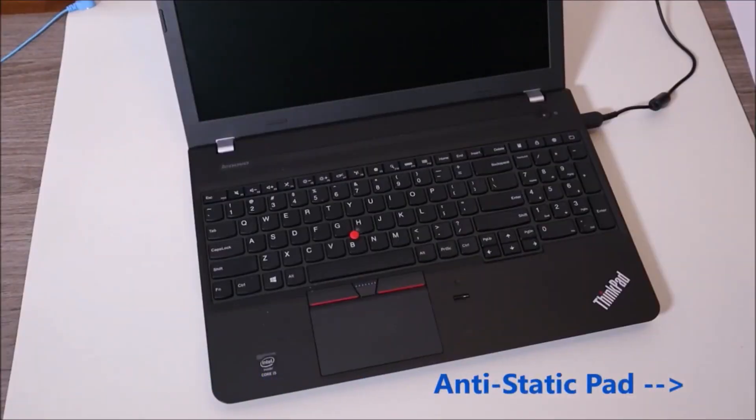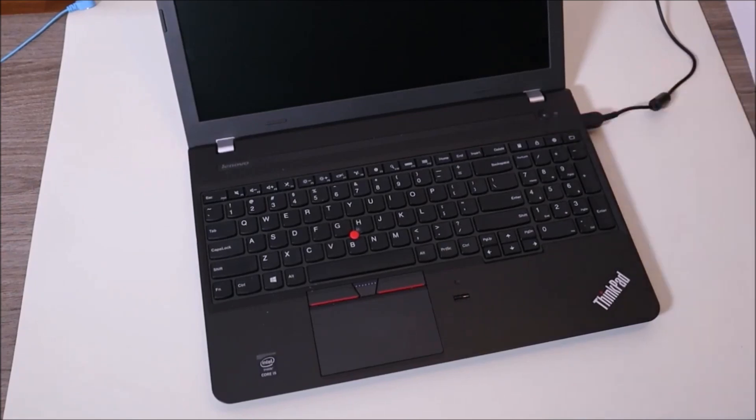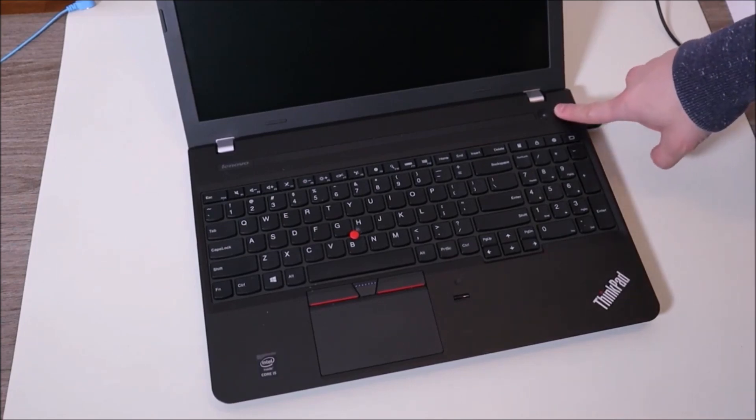The laptop computer I'm going to be using in this demonstration tutorial is going to be a Lenovo, but all the parts are the same parts you'll find in your brand computer. So here's the computer not turning on. The first thing I'm going to have you do is just press and hold your power button down for up to one minute. Sometimes it's simply a communication issue, so before you try anything more severe, just press and hold that power button down for one whole minute.